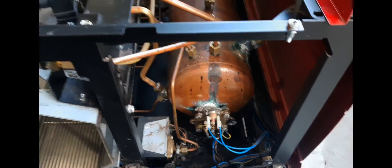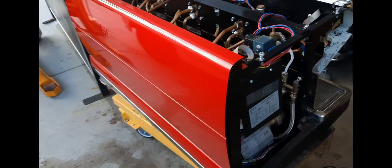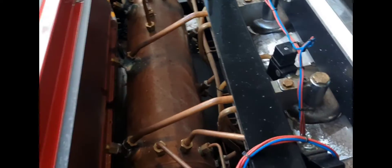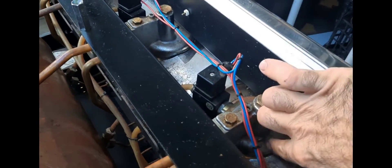On most of the machines we have, I've actually relocated the pressure stat up here, just so you don't get that issue. Other than that, it's a flawless and good-looking machine. With the sides off, you can see it's very effective, with fantastic group heads. The solenoid spits out the side, where the E61 spits underneath.